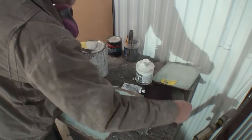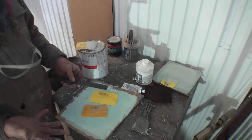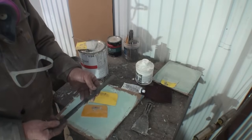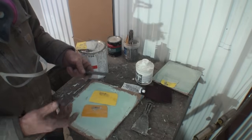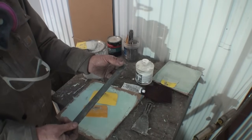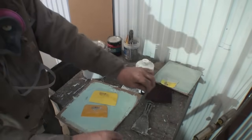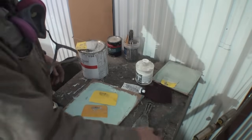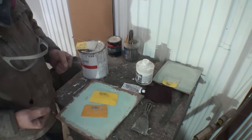Let me go ahead and grab this. When I've got big, flat areas, let's just say, now I can't use this on this car because the quarter panel is like this. But if there was a giant area that I had a bunch of door dings in, or possibly a big dent that we just got done hammering and dolling, I might take this thing right here and use it to go across it, or on a hood, level it out. I might use something like this. So it all depends on what you feel comfortable with using and how you have learned to do it.